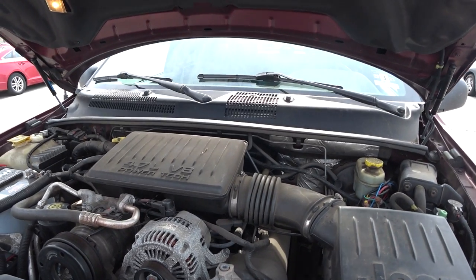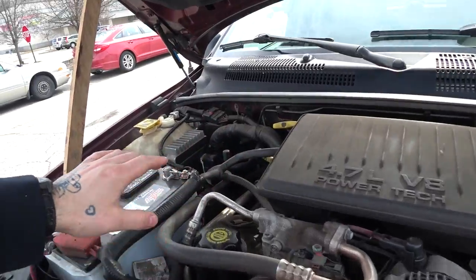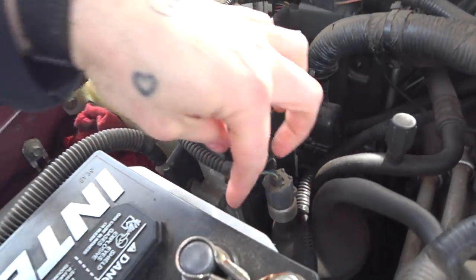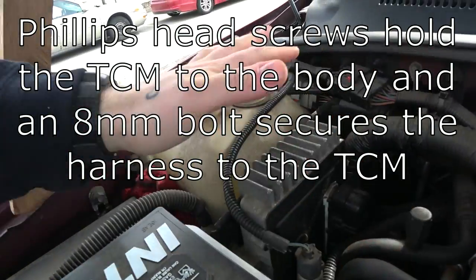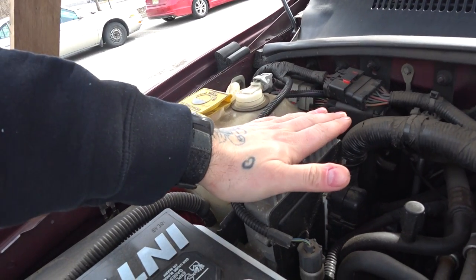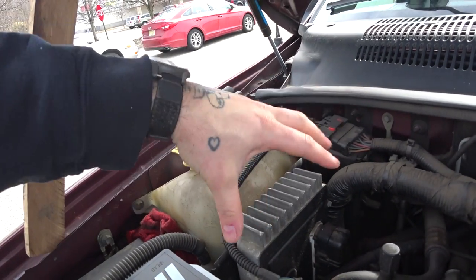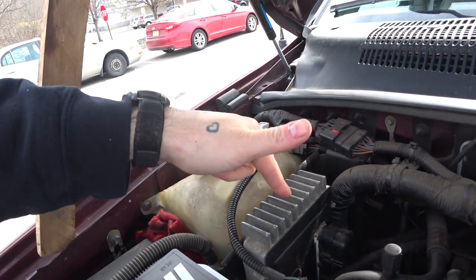I'll include a clip at the end showing where to find the TCM inside your engine bay. This is the same for all year 4.7s, including the HO. Looking at the engine bay, right here — that's your TCM. It's got a couple little Allen key bolts on either side, and then this is the main harness. You pull that off, put the new one in — that's all there is to it. For the record, this is an independent TCM; you're not changing your ECU at the same time. Some vehicles like the 4.0L have a transmission controlled by the ECU as one unit, but this is just your transmission control unit.